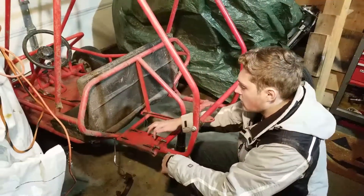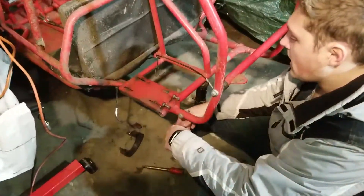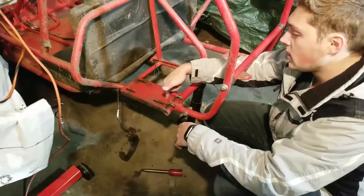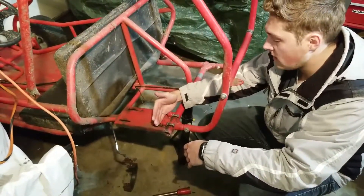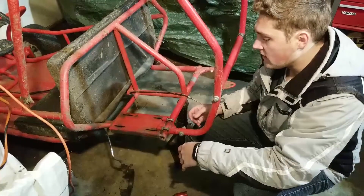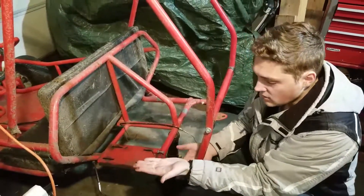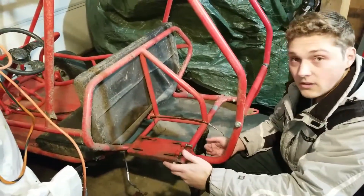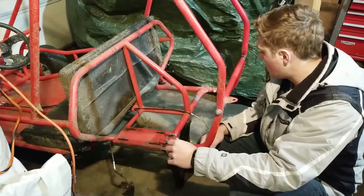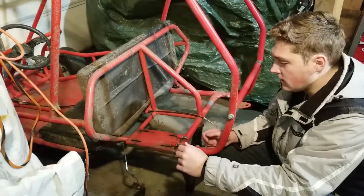We're going to run into a little difficulty here, because one of the bolts for the pillow block is going to run straight near the engine. If we run a bolt here, it might just clear the engine because the engine doesn't start until about right here. Another difficulty is these bearings are flat steel, and obviously the tubes are curved on the outside, so we can't mount it straight up under there. We might have to do some welding, but let's get those things out and see if we can get them fitted.